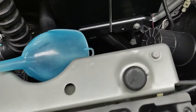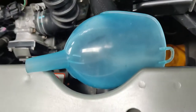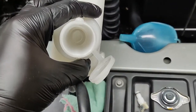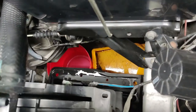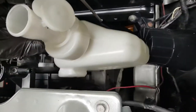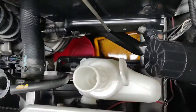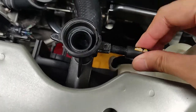While waiting for the draining to stop completely, I took the time to clean the coolant reservoir. I rinsed the inside with distilled water to make sure no old coolant is left behind, so it won't contaminate the new coolant. Then just put it back into its latch, making sure no wires are pinched, and reconnect the hose back to the radiator like before.